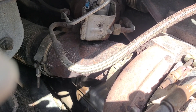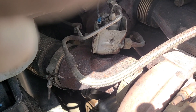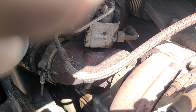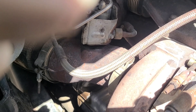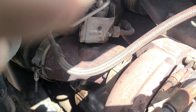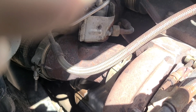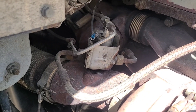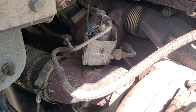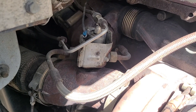I looked through the records on this truck and we haven't done it on this truck at all. So it's probably got 240, 250,000 miles on that doser valve. I've got a new one on the shelf, but if I go to replace it I'm going to have to take the coolant lines loose and lose a bunch of coolant. I'm going to spray the thing off and see if she comes nice and clean. I'm not getting codes, but I have noticed when I do my regen my EGTs don't get as hot as they used to. A sticking EGR valve will also keep you from developing the heat you want. This is just preventative maintenance - clean it off and bolt it back together.